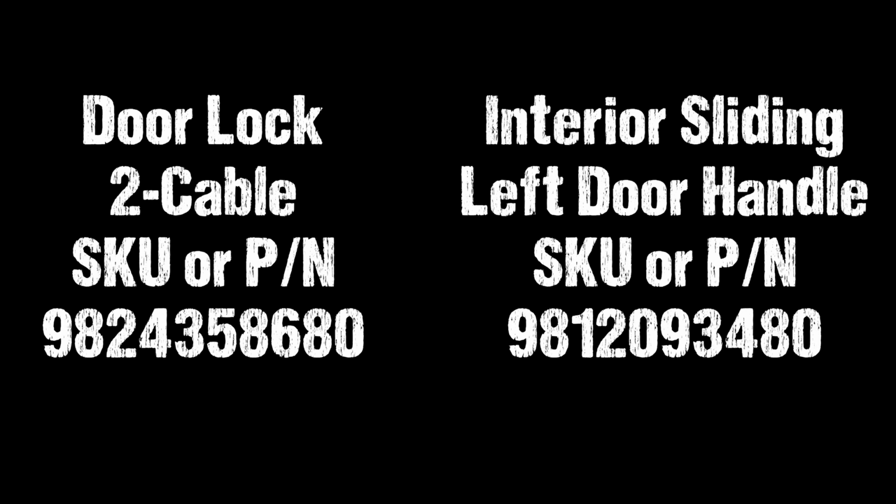If you've got one of these small vans and you want to turn it into a micro camper, that's what you need to do. You need to find the passenger equivalent door lock and make sure it's got two cables. This is the part number. Make sure it's got two cables, and you can retrofit it to this. And once you've got it all inside and working, you can open your sliding door from the inside. Absolute game changer for a small van if you're going to turn it into a micro camper.